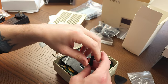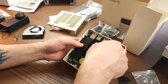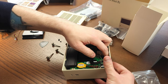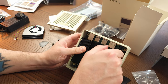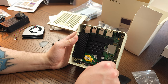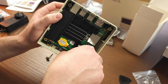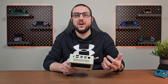I started removing the fan — three screws and unplugging it from the board — and underneath is the heat sink. Then comes the fun part: you need to remove four screws, but the manual shows three. I spent a good half hour not seeing the fourth screw, which turns out is hidden underneath the heat sink, requiring you to dismantle everything to reach it. At that point I gave up, so my recommendation is: don't take it apart and don't expect to add storage.